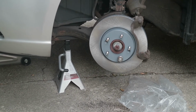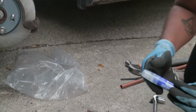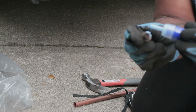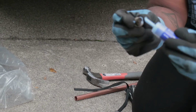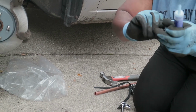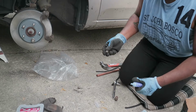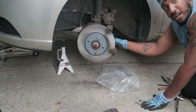And now, we take our mounting bolts, these two right here, and put a little bit of thread locker on. What the thread locker is gonna do is minimize vibrations to a certain degree, because this is a car, wheels spin, there's gonna be a lot of vibrations. So thread locker makes sure that it doesn't loosen up over time. Put a little bit on there, all around. It's probably not enough, but hey, I feel like it's good. Y'all think it's good? If I die, I die, right?